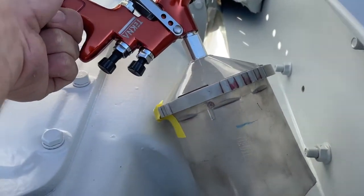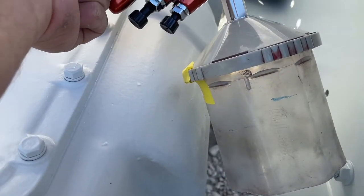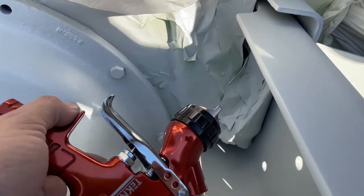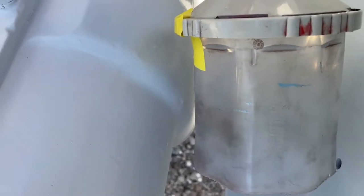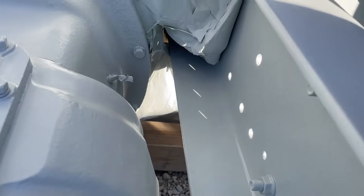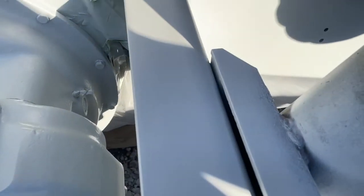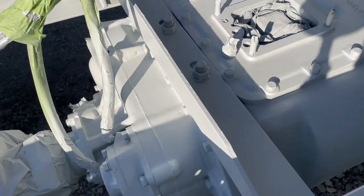But if you look, everything on the frame rail is gonna be wet, right? But my gun is so close to the transmission, especially here. I mean, I'm too close to shoot the clear there unless I'm touching the transmission. So there's just no way to see the setup. You can also kind of stick it down underneath and kind of try to shoot up through that crack, but you cannot get a good consistent coat of clear. Not that the bottom of the frame rail really needs a real consistent coat of clear, but